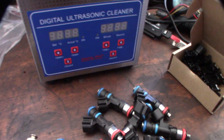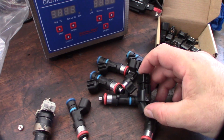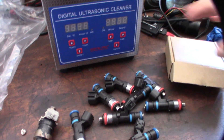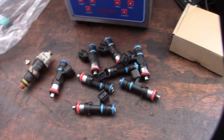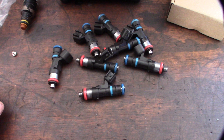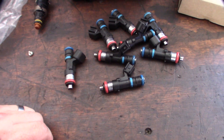I'm not going to do a cleaning video here — I'm going to make separate videos for cleaning these. This will just be the conversion. I do have these little adapter pieces. So I'm going to clean these injectors, backflow them, put them on my ultrasonic cleaner, and get this converted. I'm also going to change the fuel routing on the engine when I take the intake off. I already have the specs on these injectors, so when I go into my EFI I can program the on and off times — that's actually important any time you change your fuel injectors.